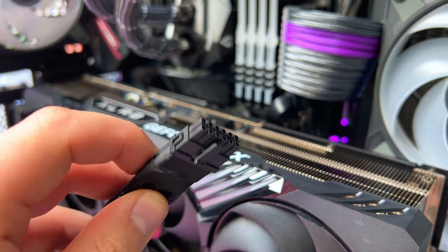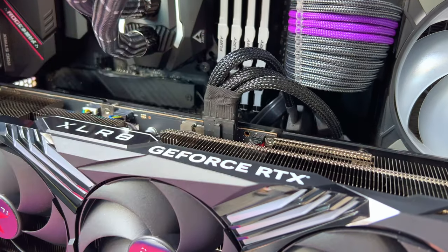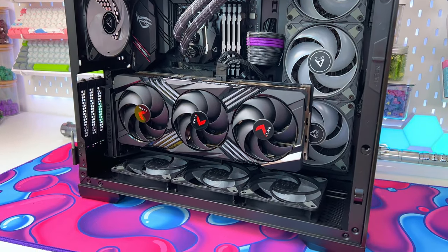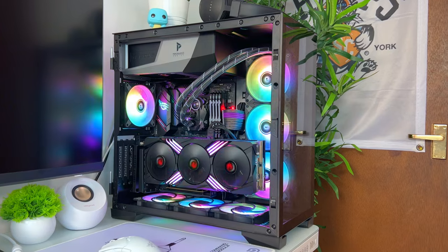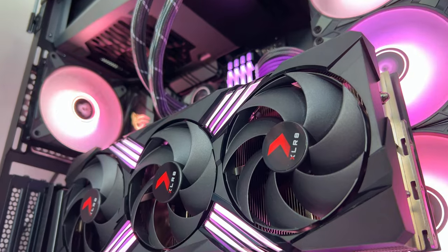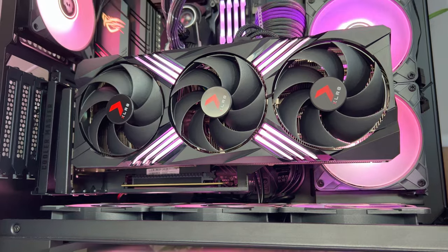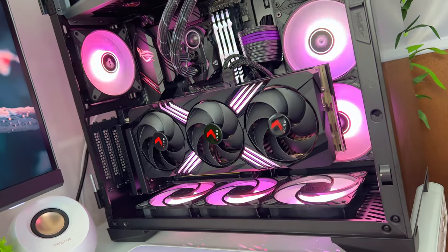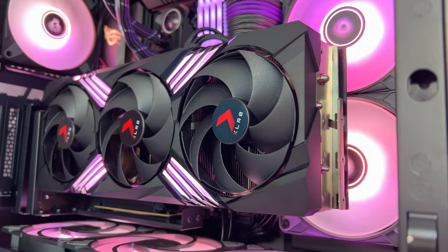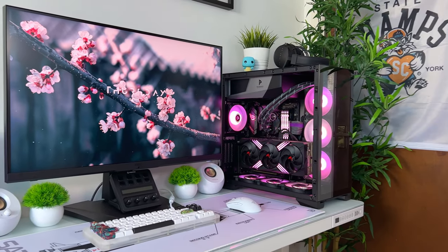Finally, we need to plug in the power cable, which of course is different on the 4080 as it uses this single 12-pin connector. With everything plugged back in, it's time to reconnect the PC to the setup and power it on. And there we go, everything powers on absolutely fine and this PC build looks so much better now that we've got the brand new 4080 in and having it vertically mounted, which I personally prefer. It's incredibly easy to mount a GPU this way and pretty much anybody can do it, especially with this Cooler Master mount that is essentially universal with most cases. I'm really happy with the way this turned out, but let me know down in the comments which version of the PC you guys actually preferred.